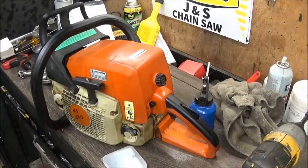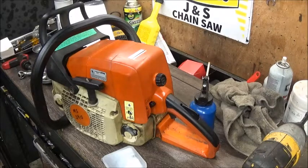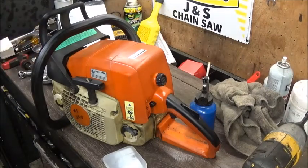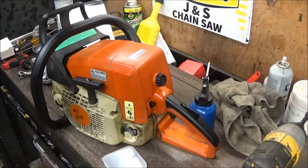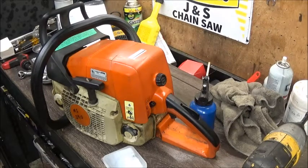One of the circlips for this one was laying out of the pack, so I'll put that in a magnetic tray for now. The rings - I think these are 49 millimeter for the big bore. The stock is 46. We're probably missing a circlip with that kit, but the Cross had both circlips - no big deal, we're not using this piston anyway.